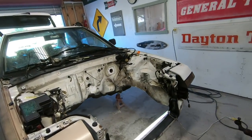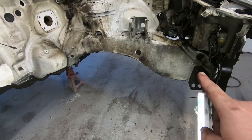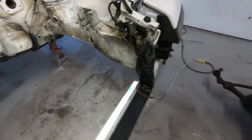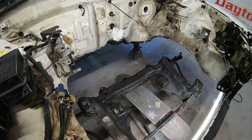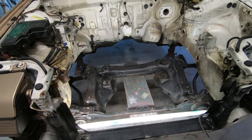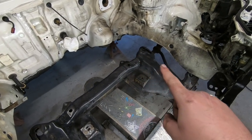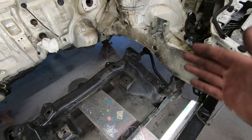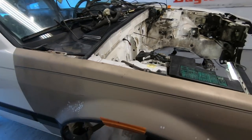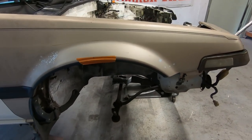The next thing I want to do - if you can see the frame rail right here, that shape is just kind of crazy. That shape is not going to be the shape it will remain. Part of this bottom will probably have to be cut off. Let me throw this subframe in there just to kind of mock it up and then I'll give you a little bit more insight on what exactly I'm thinking. This is an extremely loose representation of what the GTO subframe is going to look like inside the Accord, where it's going to live. I'm going to have to box in everything and link it to the frame. We made these reference points in the last video - that's got to be perfectly in line with the ball joint, because that's where the wheel is going to sit.